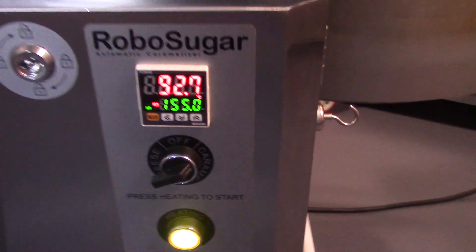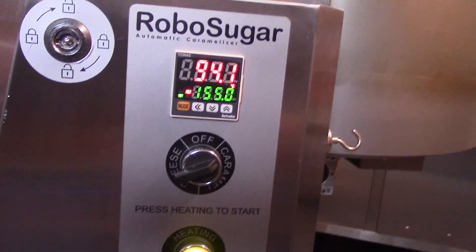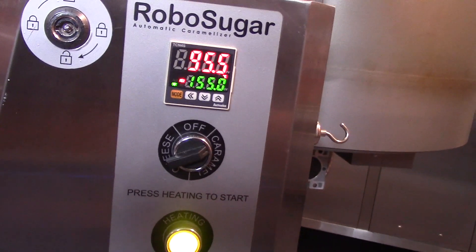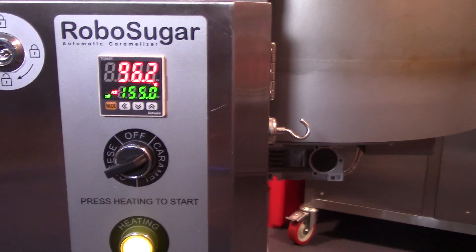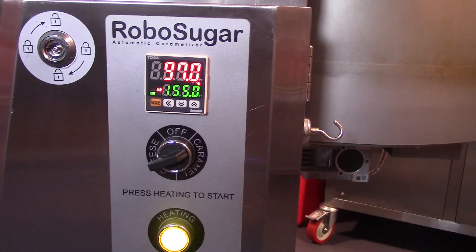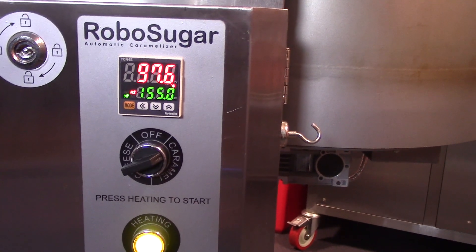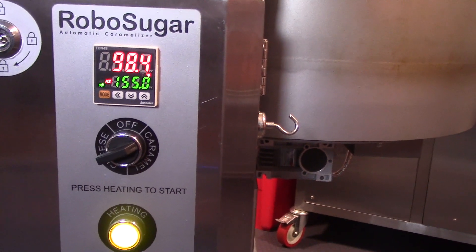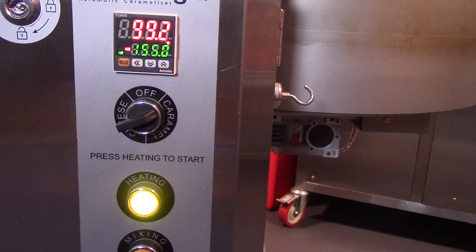The switch below it is clearly an on and off. Notice to the left it says 'cheese' — consider that savory mode. Cheese is probably the most popular non-caramel popcorn people make. Savory mode works the same way with a couple of nuances: first, it's a much lower dump temperature, usually around 50 to 55 degrees Celsius. Second, instead of being a constant-on heat, it uses a pulse heating system so as not to burn ingredients that could easily be over-dried or burned.